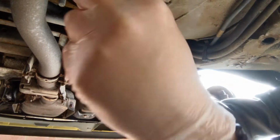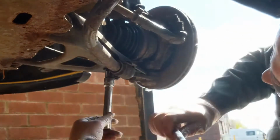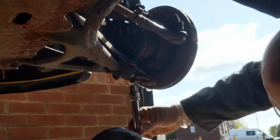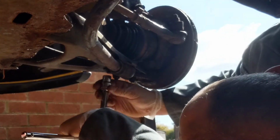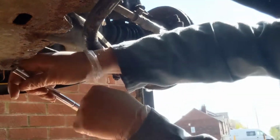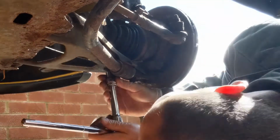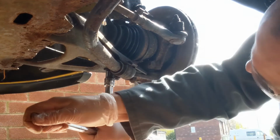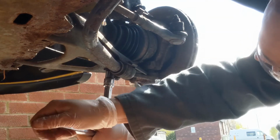Have you been working on something like this yourself? Drop a comment below. Now you may recall I mentioned that there are no drop links at the end of the anti-roll bar on this vehicle, so rather we've just got a bar going directly onto the lower control arm. There is a U-shaped clamp and a single bolt holding that in place.